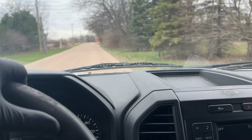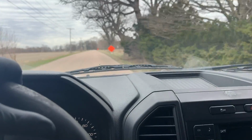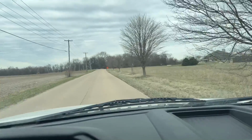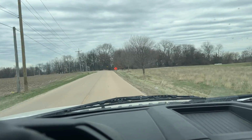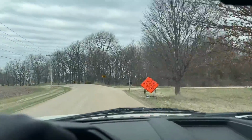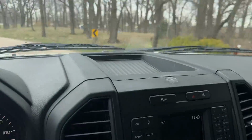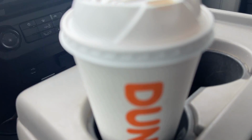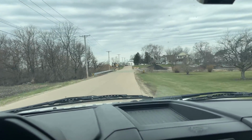And now we're just going for a drive so we can learn the shift points, and we can heat it up and clear out the rest of the air bubbles in the fuel system and stuff like that. Get the engine nice and hot a couple times, let it pressurize and sit, that kind of stuff. Hot soak, stuff like that. Really test the cooling system integrity in general. We can make sure the heat is coming out the vents here, all that good stuff, just from cruising around, sipping your coffee, and going for a drive. Tell you, this job is not too hard.